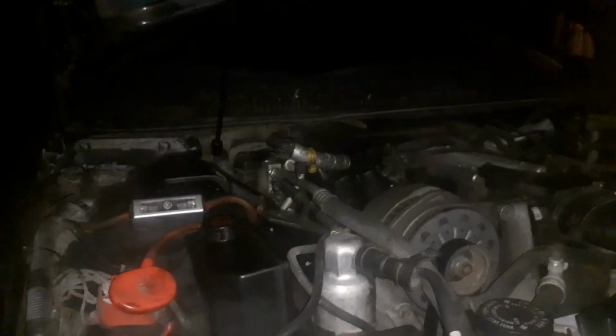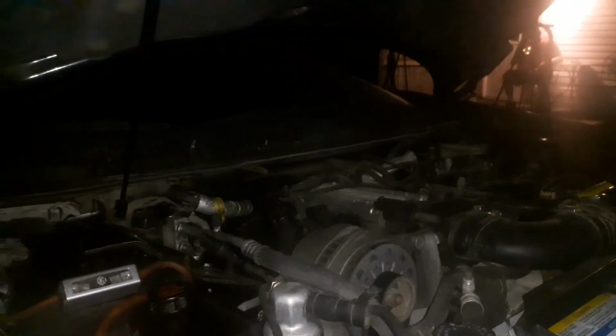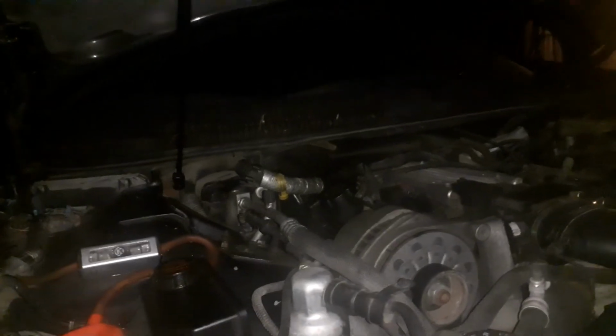But I'm going to have to get it off the stands first, because I'm not going to be able to tell where the fluid level is with it sitting backwards like that. The back side, it's too dark back there, but the back side's just on the ground. The front side's up on these wooden blocks I've got. But yep, put it down on the ground. Drive it back and forth a little bit, check the fluid, get it up to temp, check the fluid, put more fluid in it, top it off, and then stick some cardboard under there and start it up and go back and forth and see if I get any leaks on my cardboard, and then go from there.